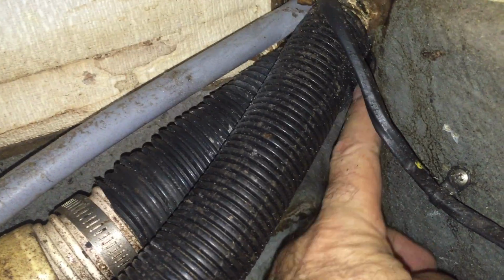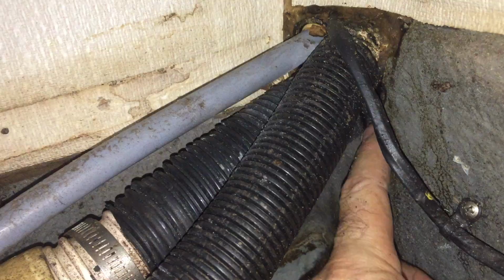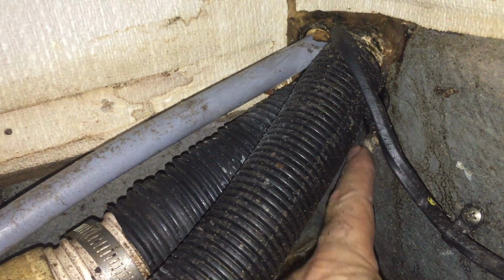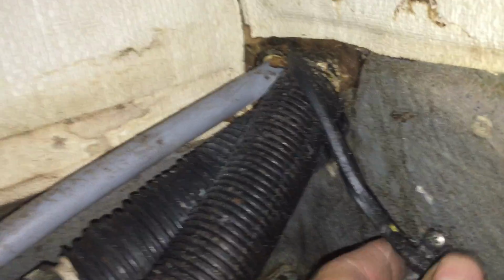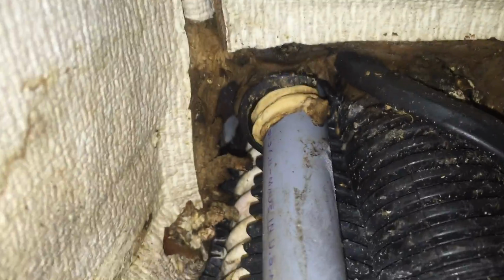We're going to check. There were some signs of water coming in from the next compartment, which is where the freshwater pump, the sewer tank and the water heater are. It might have been coming in through here. We're going to check this thoroughly before reassembly. It easily could have been, as these go through chafe sleeves, so there's not real sealant. They're not very tightly sealed. They're just meant to protect the pipe from chafing.